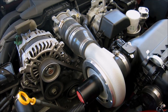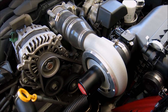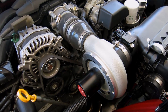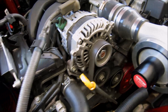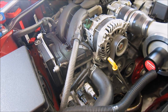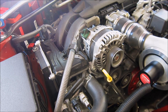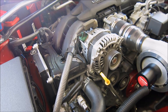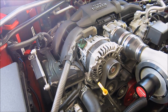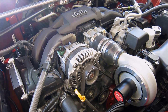This supercharger is a two-stage activation. It has two PSI at the first stage, and a full 5 PSI at the second stage. But all this is activated by a mechanical throttle position switch, which is kind of old-school. There is a newer digital electronic way called Proceed from Vishnu tuning, but I'm still using the old mechanical activation switch.